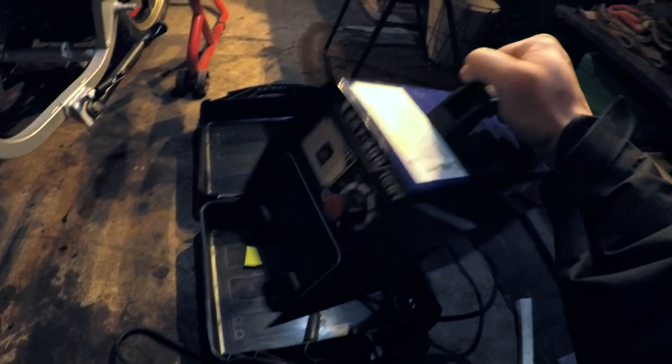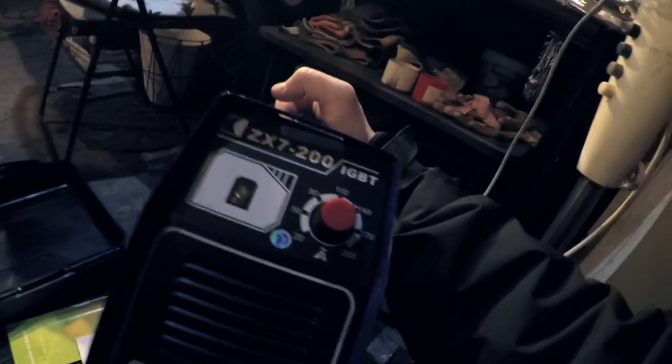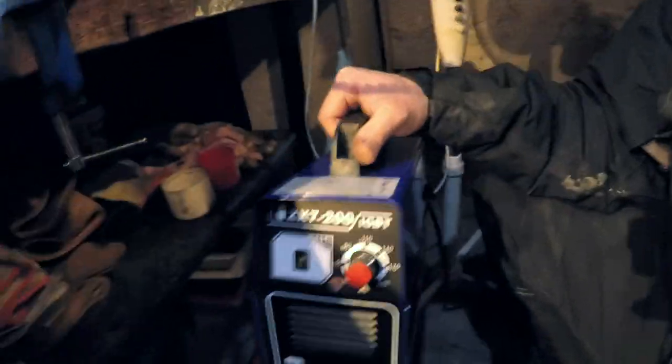I've actually built something really cool with this welding machine — I built a trailer to carry this bike and it's been on the motorway and everything's fine. It was initially 1.5 by 0.9 meters and I needed to extend it to fit the bike, so I made it 2 meters by 0.9 meters. I used this 40-pound welder off eBay and a bunch of welding sticks. It's still working half a year later — I like this cheap eBay welder. I'm not a professional welder but I'm trying.